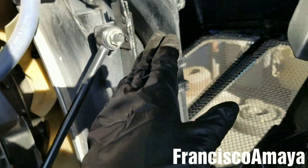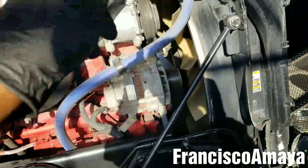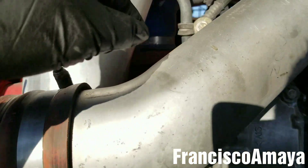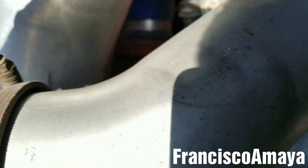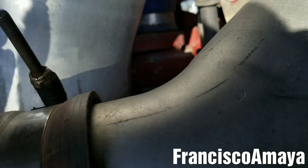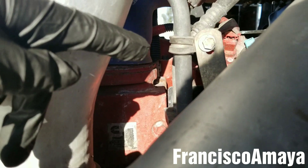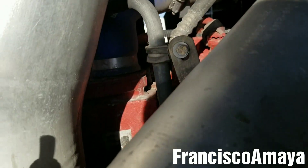Then you check the front of the radiator. If there is nothing in the front, that means there is no problem with the radiator. So the last thing to check is the thermostat, and the thermostat you cannot check it — you cannot see it. So you have to remove it or replace it. There is no other option. So if you want to know how to replace the thermostat, I did a video — I'm going to leave the link in this corner over here or in the description below.